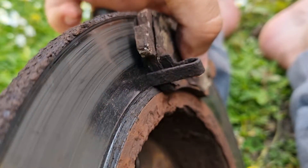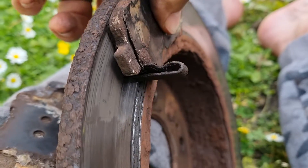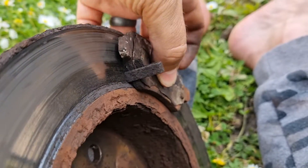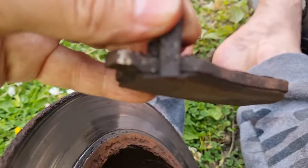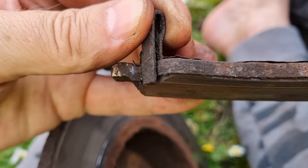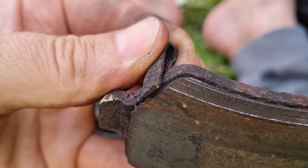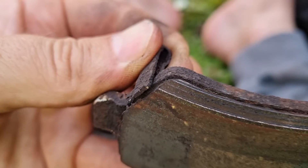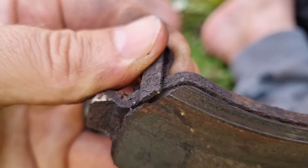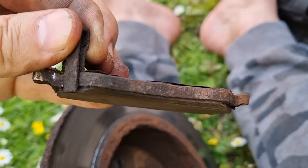It is touching the rotor disc, and that thing is designed to vibrate like crazy and make a total squealing sound to let you know that your brakes are running really low. If you have a look, you can see the pad is actually worn down to a level where it's starting to make contact with the brake disc — which means your pad is pretty much done and it's time to replace.